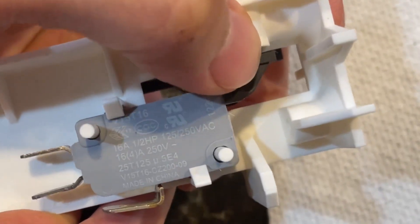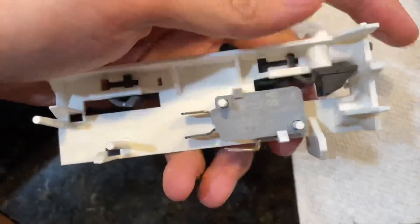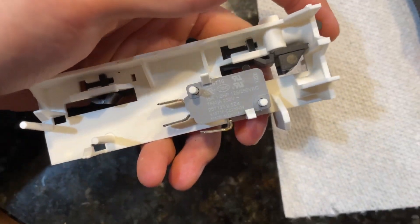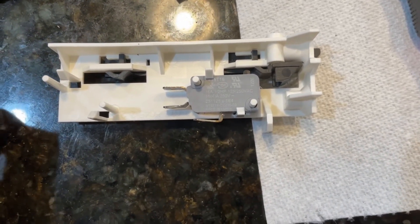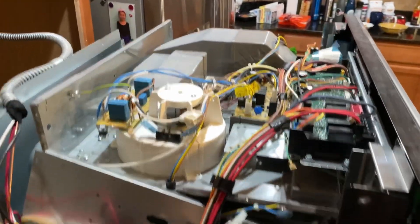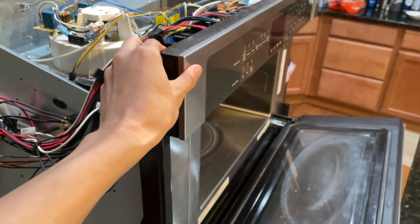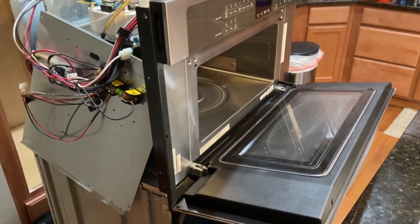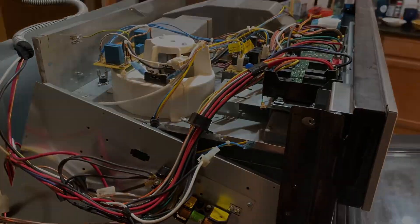You actually have to physically push this down yourself once the switch is fully depressed to hear that clicking sound and ensure the circuit is closed. This switch was not closing, which made the microwave door think it was not fully closed, so the microwave would not start. Unfortunately this is the current state of the microwave with the entire front piece just hanging off — but anyway, that was my two hours of debugging this mechanical issue.